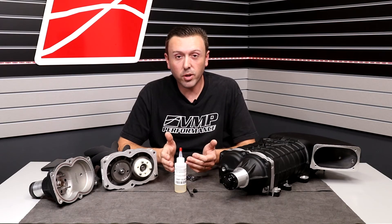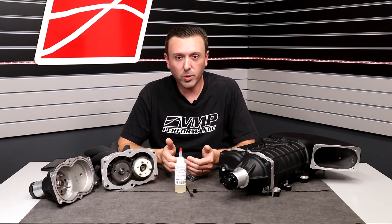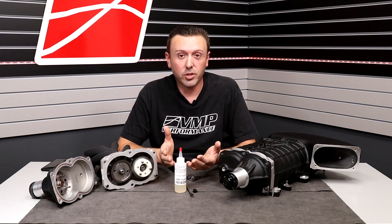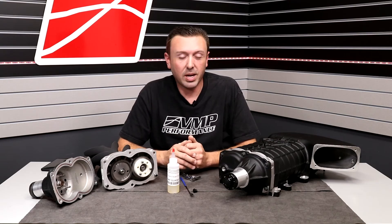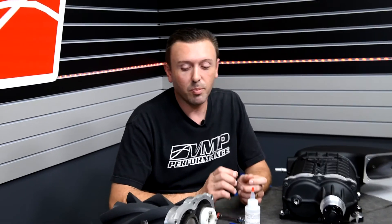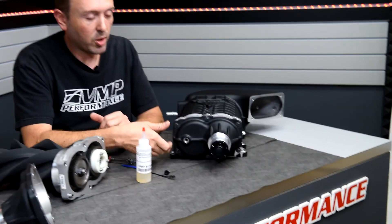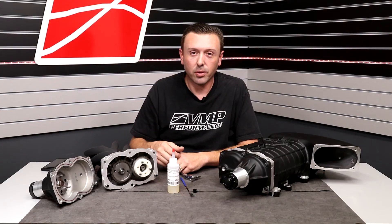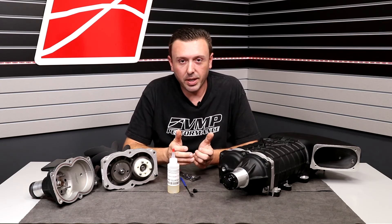A lot of what I'm talking about is in reference to a brand new supercharger — yes, they come filled with oil and are all spin tested before they leave the factory. If you need to check the oil, here's how you do it. What if you need to replace your oil? We do sell replacement supercharger oil, and it is possible to drain the oil out. The best way to do that is to remove these six bolts, put a plastic bag under the nose drive, pop it off, catch the oil, and clean everything out with carb cleaner — just spray them off here and here, then bolt them back together.